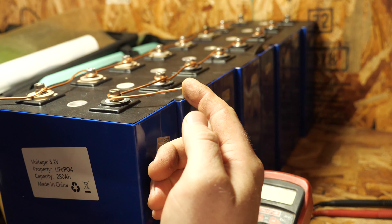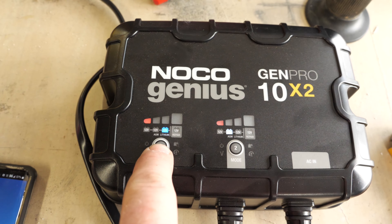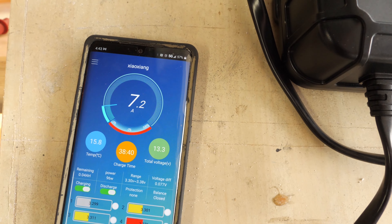We got the cells in, top-balanced them, and fully charged them. When you charge lithium you've got to have a charger that allows a lithium profile — it knows it's charging a lithium battery, you can't just use a regular charger. In my search for that I tried NOCO. I love their jump starter, but I've had issues with them — good customer service, they've always fixed the problem. The NOCO new gen X4 allowed multiple profiles for each output, so I could put my starter battery on lead acid mode and all my house batteries on lithium mode.